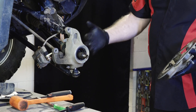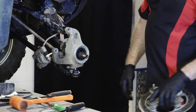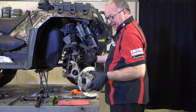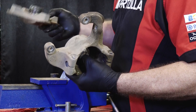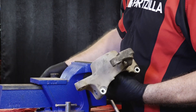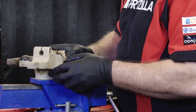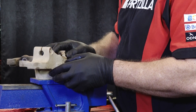Now that we've pulled it apart, it didn't come apart the way the manual says it should. What it actually did was destroy that inner bearing, so we're going to have to replace that. With that off, all we needed to do — had it come apart as it should — is knock out these studs, replace the disc, and put it back together. But the inner carrier actually stuck to the axle or hub itself. I'm going to have to pry that off — I'll try it on the vise on that flat surface and see if I can get it started.